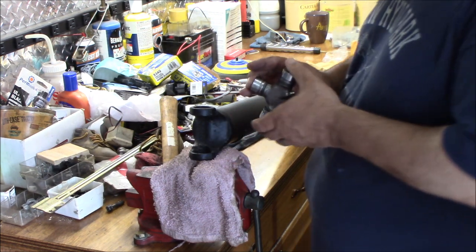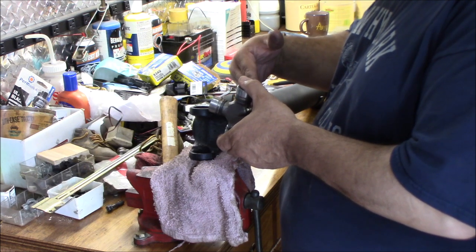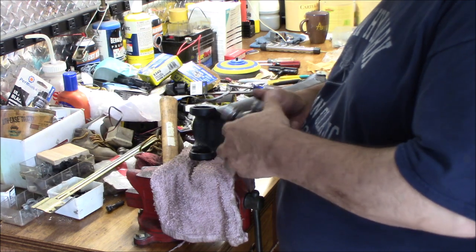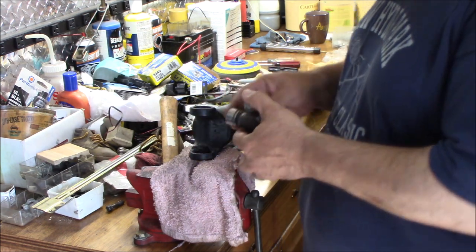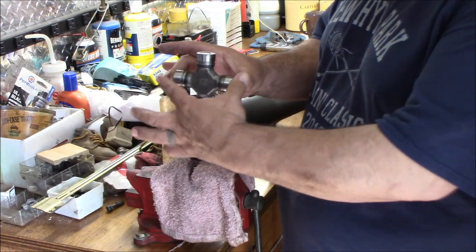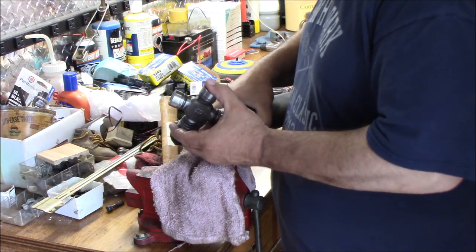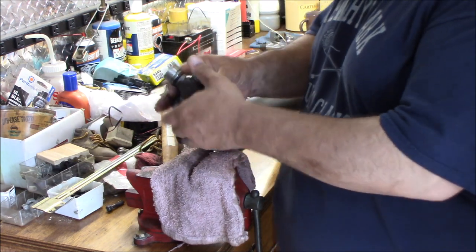Same thing. So this one's going to come in on an angle like this. So putting the Zerk on this side, when it's down here, would make the most sense. So putting the Zerk going out this way. Now two caps are going to stay on whenever we take them off, because those are going to get strapped into the rear end. And then we've got two caps that are going to come off and we are going to install them in.